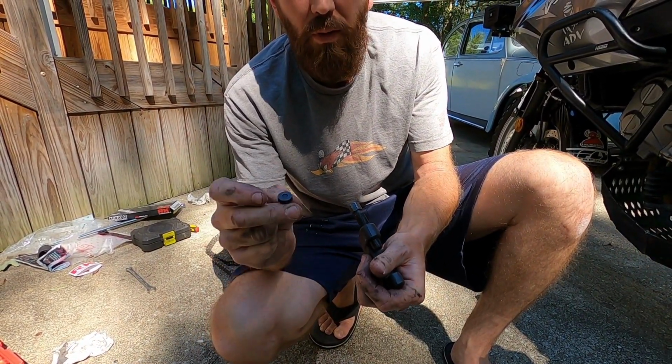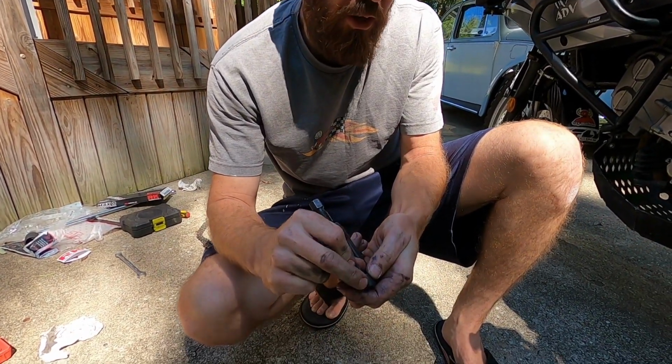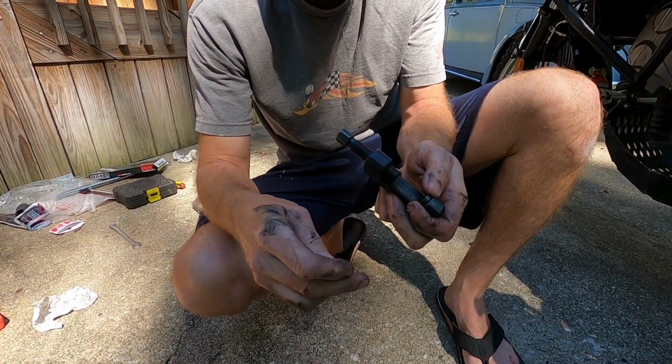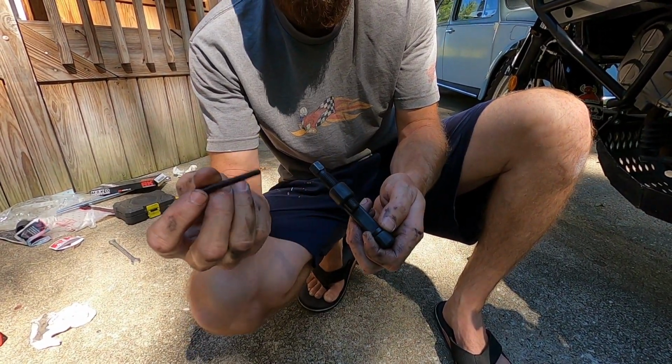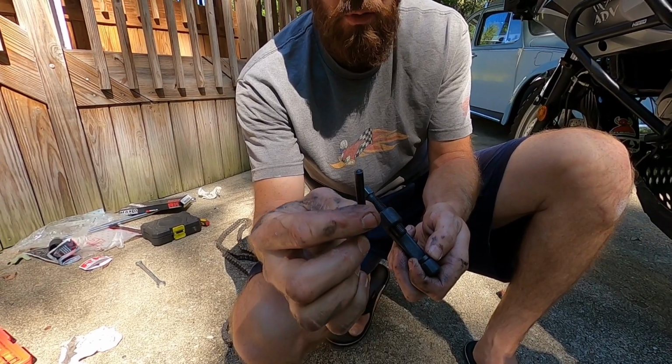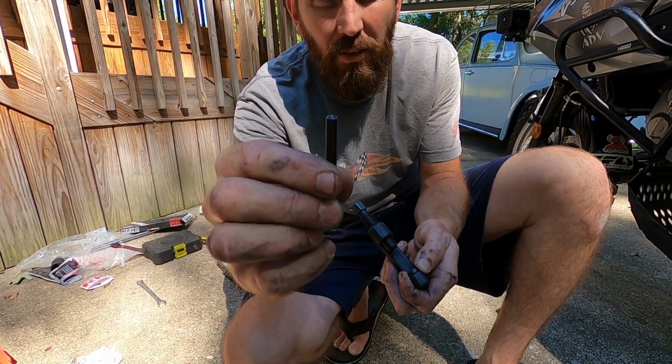You need the anvil. It's probably the biggest size for a big bike chain. Put that on your other side. That's just gonna catch that other side of that pin from coming out, or so the link don't move. And you're gonna need your flaring, with your riveting pin. See, it's just got a little tip on the end. That's just gonna flare it out.